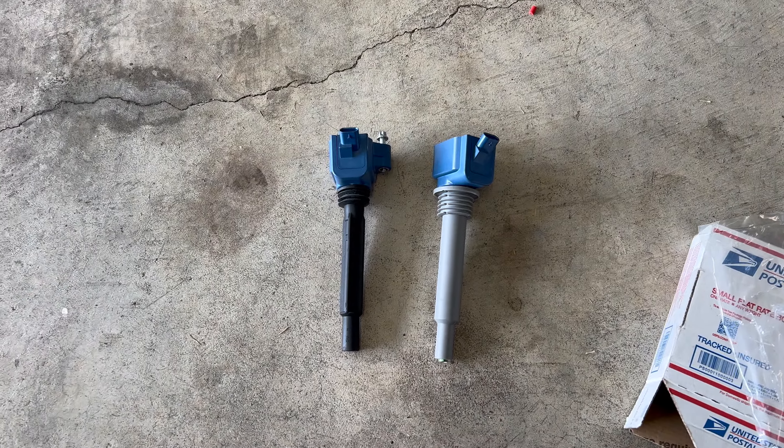I decided to stop being lazy. On this first set of coils I went ahead and removed my Nexus bracket — you can see them pushed firmly in place, seating really nicely around the ignition coil housing. However, without the bracket seated all the way down, I don't have anything to run my bolts into. And there's not a huge difference in height between that one and the two behind it. My concern is there's nothing to keep the coil from working its way loose through vibration and unseating from the spark plug.